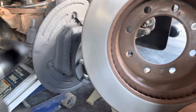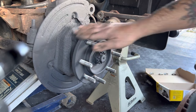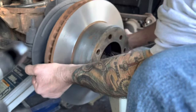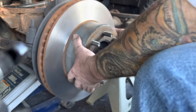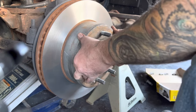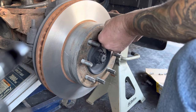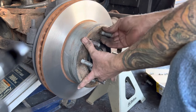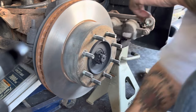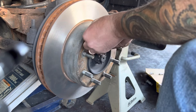I actually took the inside of the rotor too and cleaned the hell out of that, and hopefully it'll prevent rust from sticking next time. Let's figure these safety clips back out — these might just pop back on. Look at that, it slides right on there. I don't know if I should have new ones, but they seem to be grabbing pretty good.